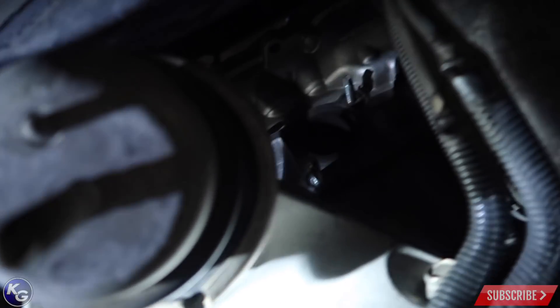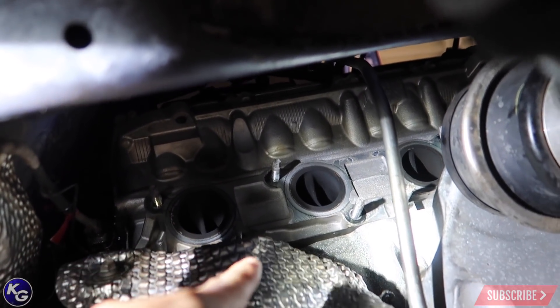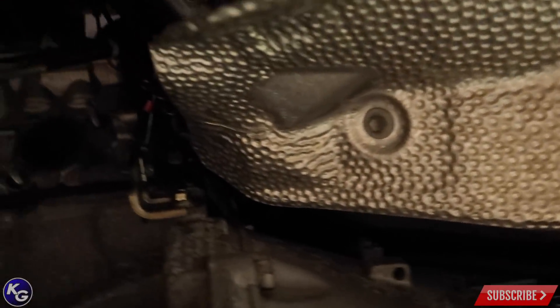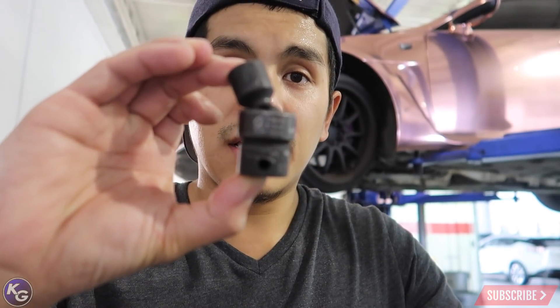It's looking really nice and clean. It broke on this cylinder - you can see it's slightly dirtier around here than the rest. When you're at this position, overlook everything and make sure there are no leaks. Mine seems to be fine, so I'm just going to clean that up and put the brand new gaskets in. When working on your header, take your time and be careful. Have all the types of swivels you need - some are too fat and will get in the way of corners and bolts you can't reach.